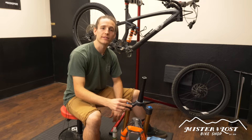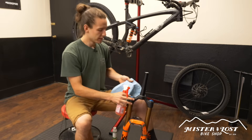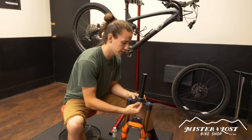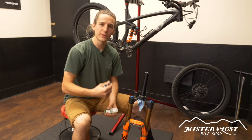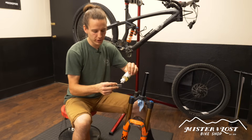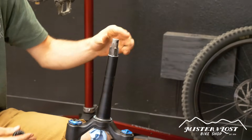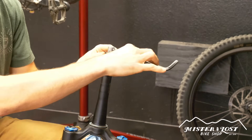The next step is to tap the steer tube. But before busting out the tap, grab some degreaser, polish, rubbing alcohol, or even water — spray down a rag, get it nice and wet, and shove it in the bottom of the steer tube. This will catch any metal flakes that fall down when we're tapping. Then grab the tap from the tap kit — these things are built idiot proof. Cover the tap in a bunch of chain lube, which acts as your cutting fluid. Place it into the top of the steer tube, take the cutting guide and place it over the tap, then grab an 8 millimeter allen key and insert it to use as your leverage.